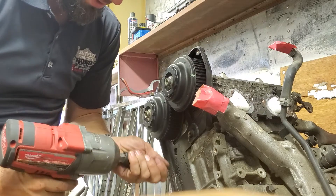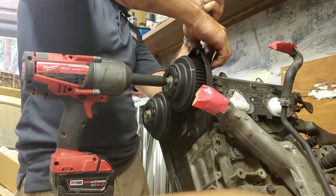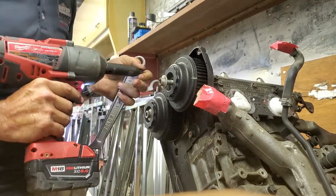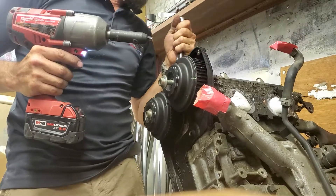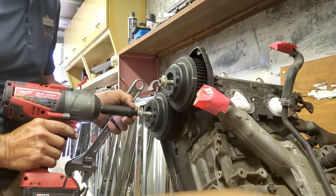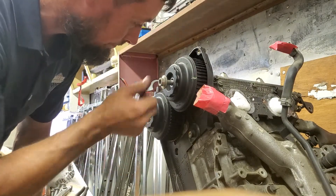As they call it nut busting, but in this case we're doing it both ways. Get that in there with a crescent wrench — that worked on the other side, no guarantee on this side. I just held it. Boom — because there are these hex flats on the camshafts that you can run that wrench on. No drilling, no heat, no torch, none of that. No special tool to hold it. And you can reuse it.